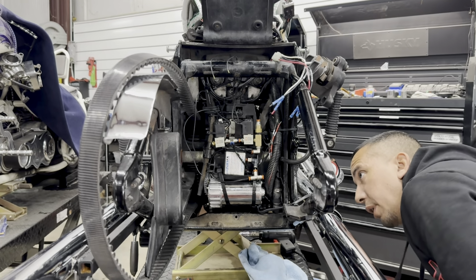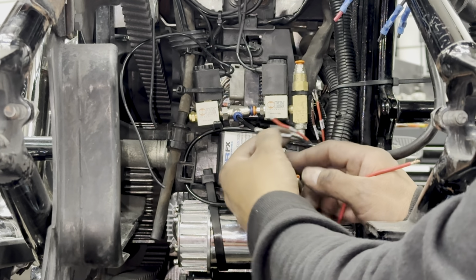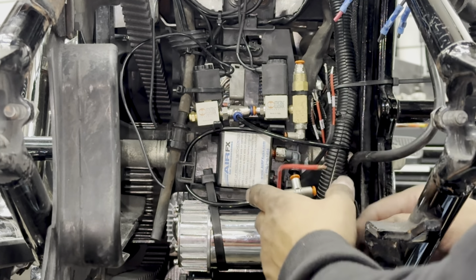Okay, so now let's start wiring. Okay, let's start off with the air compressor wiring. You got a positive and negative from your air compressor, and from the Instant Up control pressure switch box, this is what we're going to connect first. So you got a compressor plus, compressor minus, positive and negative. Of course, we're going to connect these two together. Begin by connecting the ground in.